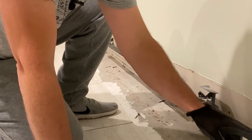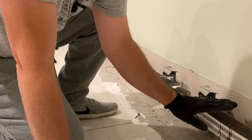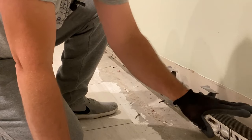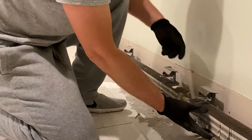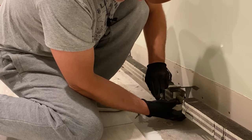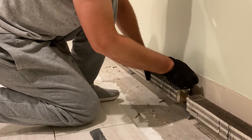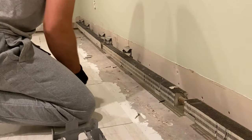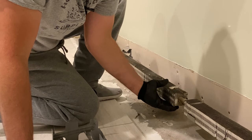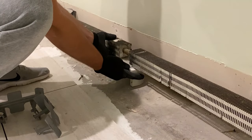Be careful with this part because this is the heating element and these fins are very soft aluminum — you don't want to damage them, so do your best not to bend them. If they get a little damage it's not a big deal, but try to keep them aligned. The easiest way to remove the element is to slide it to a position where you have no holders in the way. You also have a little play with the pipe — you can pull it out a bit — then just slide and roll the element out. Put something underneath to keep it elevated in roughly the same position, so the connections don't get stressed and start leaking.